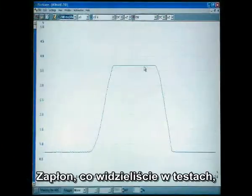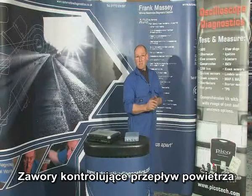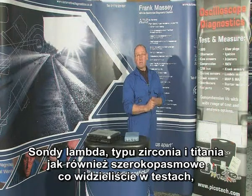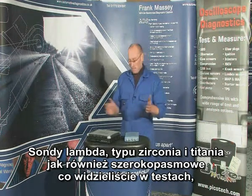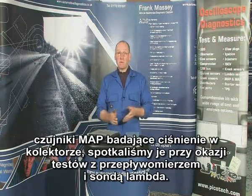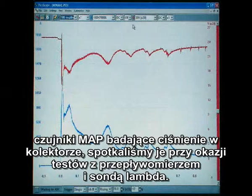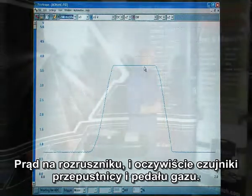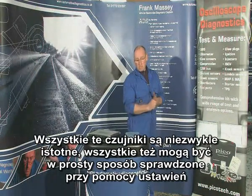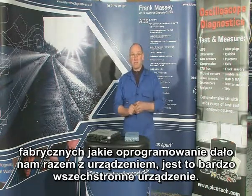Glow plugs with diesel. Ignition, of course, you've seen on the practical test. Injectors, also you've seen practically. Idle control valves. Knock sensors. Lambda sensors, of course — there's zirconia, titanium, and the broadband sensors you've seen displayed. MAP and manifold pressure sensors. You've seen the dual tests carried out practically with the mass airflow sensor and lambda. Starter motor draw current, and of course down to throttle pot. All of these are crucial sensors, all easily tested within the preset parameters within the automotive toolbar button.